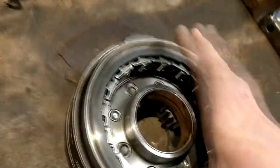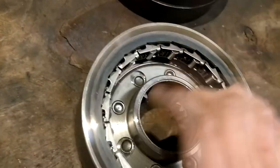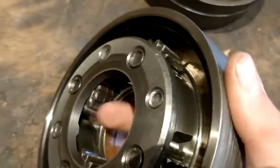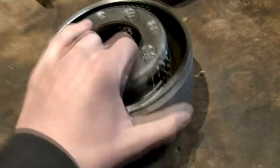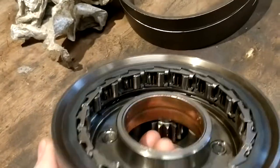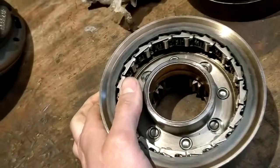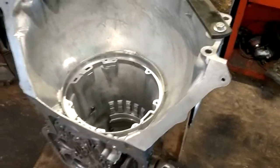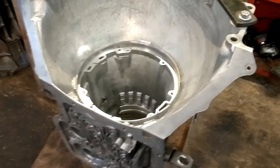Everything else is good. The reason these are the 475 is because the gears are straight cut — that's what makes them special. This part is only like 40 or 50 bucks used for a standard TH400 or 4L80, but these are not 40 or 50 dollars. This cleaned up all brand new — just waiting on my gaskets and we'll toss the thing together, throw it back in, and test drive it. The torque converter looked brand new in there. Something was done to it — I don't know what, but it looks good. I accidentally ordered a 700R4 rebuild kit, so I had to send that back and we're getting the correct one.